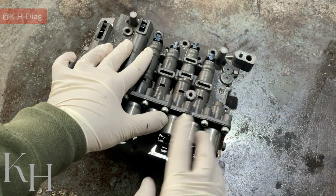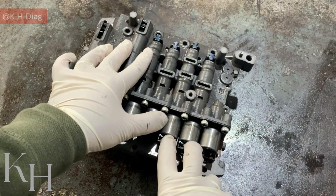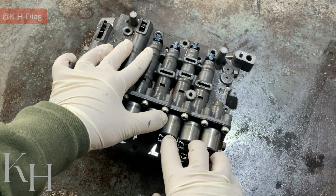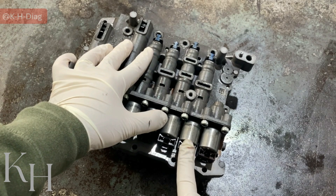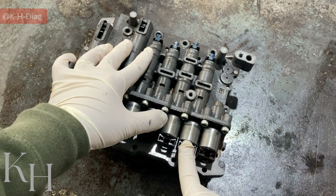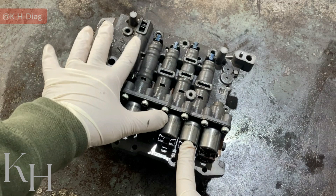When I'm saying high and low current, you can monitor it on the scan tool as well. On the other videos on the channel, you can see how I use the scanner to read the live data on each one of them. For example, for this one, when it is receiving low current, it's going to receive 50 mA, and high current is going to be 850 mA. By monitoring those values, you can see how these ones are working.